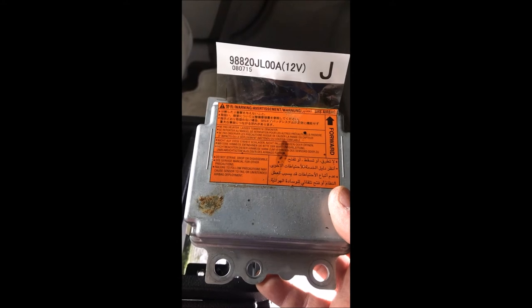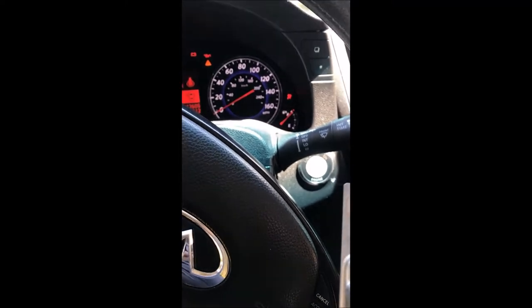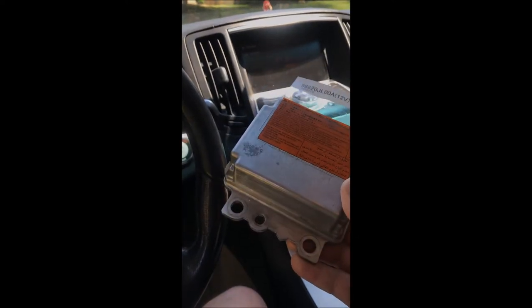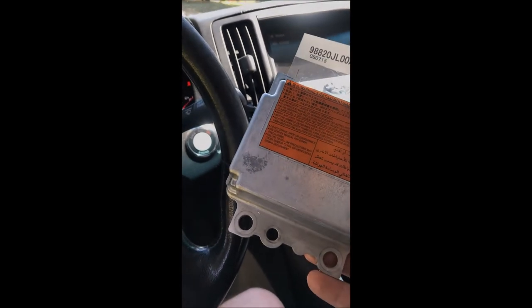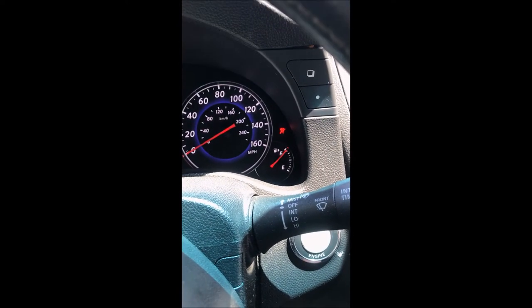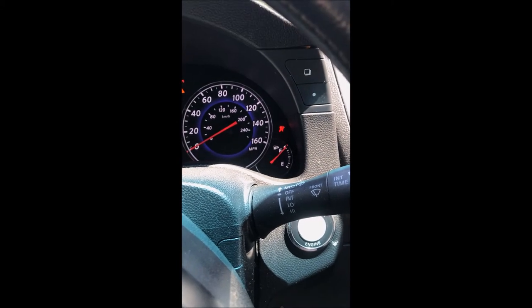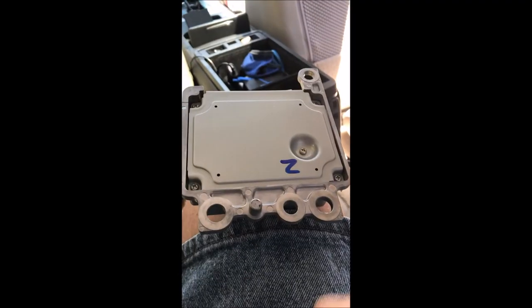Once this has been returned to me I will show you that the airbag light is turned off. Coming back here — I got my SRS module back from being reset and the crash data cleared out of it. Cost me $40 and a few days of waiting. I've got the car turned on and you can see that the airbag light is still on, so I'm going to go ahead and replace this. I'm finding that this little post right here fits into this hole right here — it's a lot easier to put this module back in and let that little post kind of hold it in place while you're plugging in the yellow connectors.